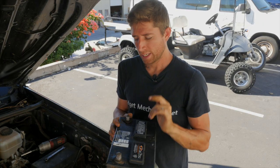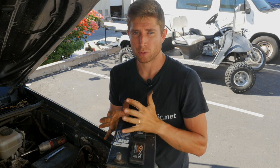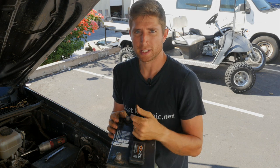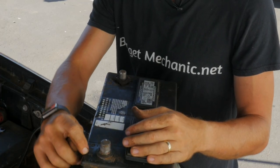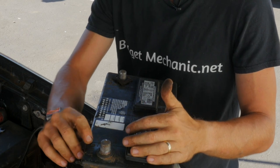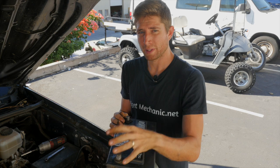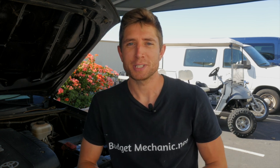Alright, you've got your old battery out. Now when you go to put the new battery in, just attach the terminals in reverse order from when you took it out — put the positive on first, finish with the negative. The positive side will be labeled usually as 'positive' or 'POS' and have a plus sign somewhere around that terminal. Often the positive terminal has a red cap on it as well. Hopefully after watching this video, you're a little less intimidated by your battery and you know how to handle it safely. Thanks for watching — please subscribe if you haven't already, and happy wrenching.